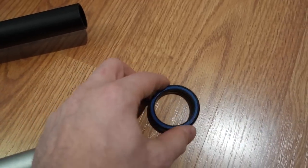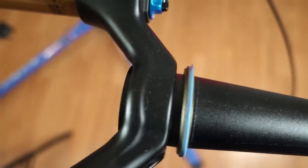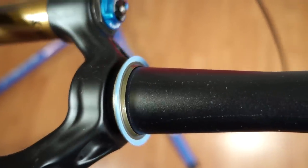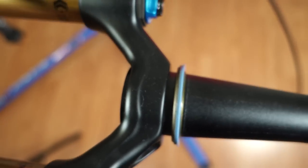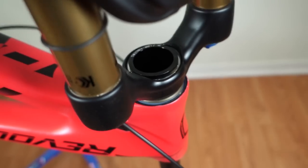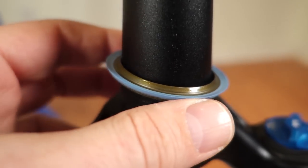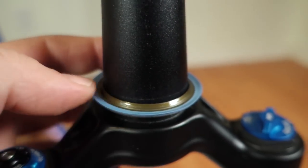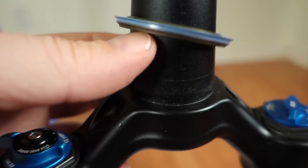Also we have to install what's called the crown race. The crown race comes with a headset and it slides onto the steerer tube, but it has to be pressed — you can see that little gap over there. What the crown race does is center the fork right onto that bottom headset bearing. If you watch my video on headsets, you know that this crown race can be split, in which case you can easily slide it all the way to the bottom of the steerer tube.